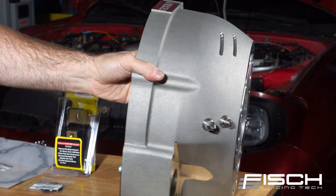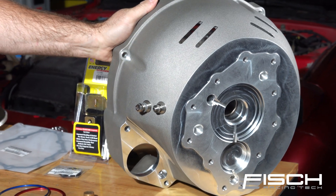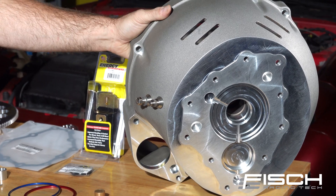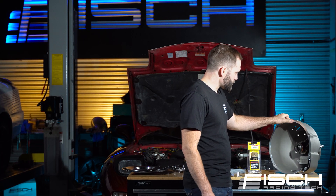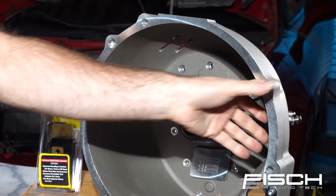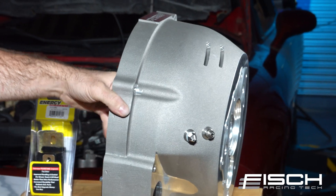This one-piece casted aluminum bell housing gets produced right here in BC, Canada — casted and machined. It comes pre-installed with a Tilton HRB, Goodridge lines, and stainless steel pass-throughs machined in-house.